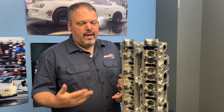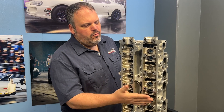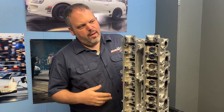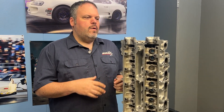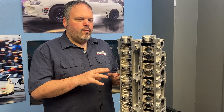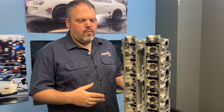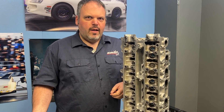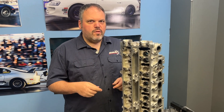We use the 5086 in everything that's fast and we don't have this problem, and it's isolated only to the exhaust. I don't see float in the valve, and on the camshaft, GSC told me they only saw an issue in the nose of the cam. If it was floating, it would beat up the acceleration side of the camshaft, and there was only damage in the nose — so they're totally reusable.